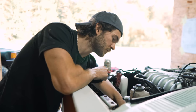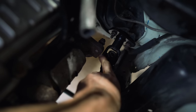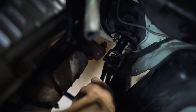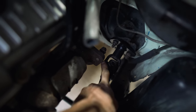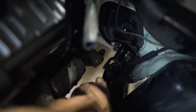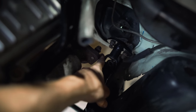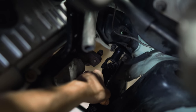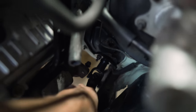This is a big problem. This isn't going to work. This is our problem — this is the steering shaft that we just made and this is our exhaust flange. When this is tight, it's right there. We've got like a tight quarter inch of clearance between the steering shaft and the exhaust flange where we need it way over. I'd be happy with a solid half inch — more like five eighths clearance there.